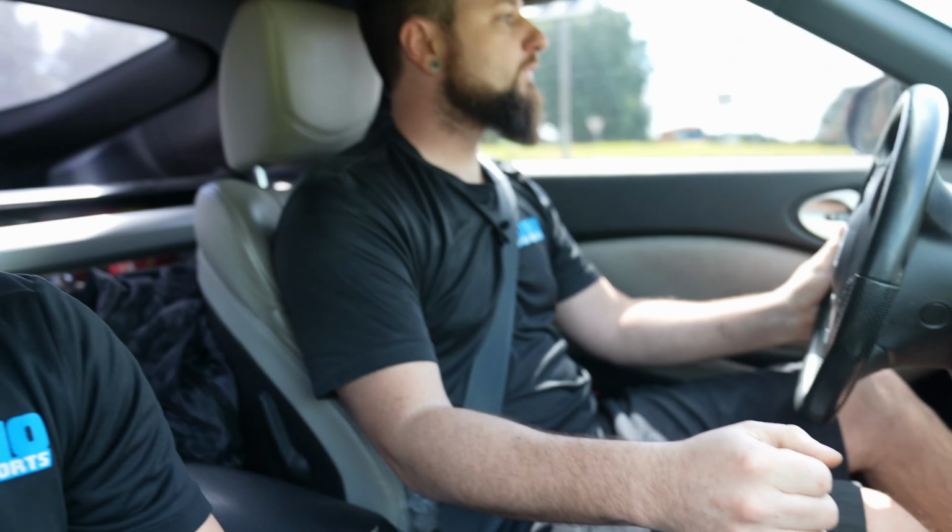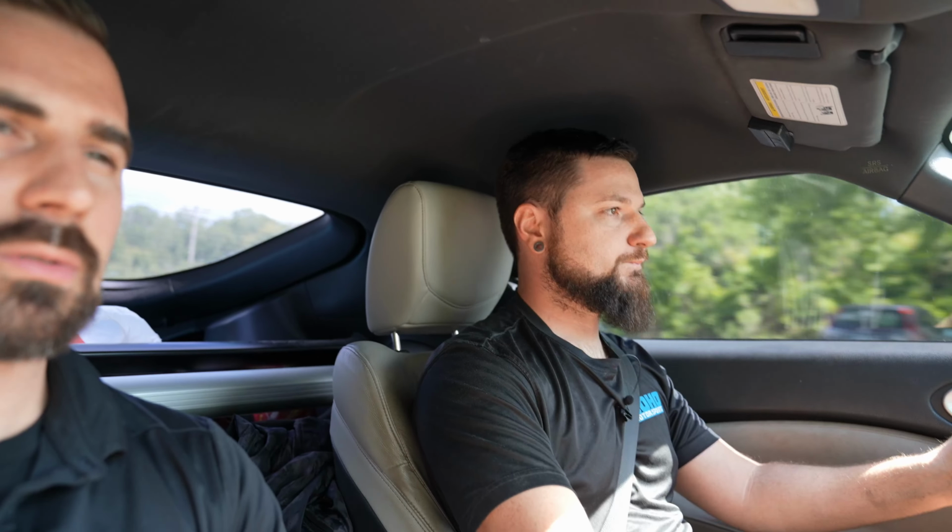Cooler work shifter. Yeah, and he changed the rear diff setup from the open diff of the base model to the full LSD, and man, that thing just shoots straight through the entire pull. No more one wheel pull, right? It just shoots straight. And when you're adding that much power to a car, it's just a must. It's just so much safer. Correct. That's the last thing you want, is to put all that power down and then one wheel has the power, the other one doesn't, and it's unpredictable. So predictability is the big thing anytime you go boost.